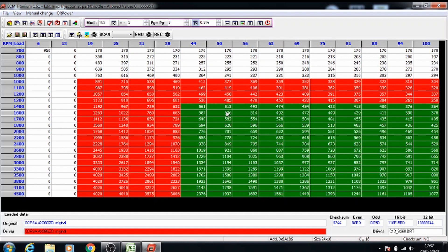Press page up again and follow this step for the rest of the map until you get to 6%. That's 3% done. That's the last section — that makes it 6% starting from here up to the bottom. We've made it a gradual change. So the digits along this row are still going in a gradual increase, same with all of the other ones. As you look down there's a gradual increase on all of them — that means it's a good remap.